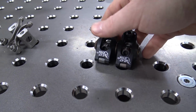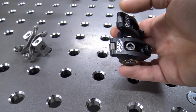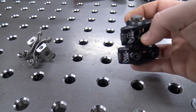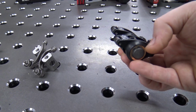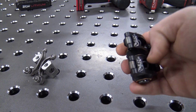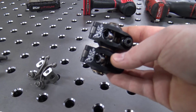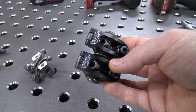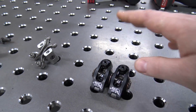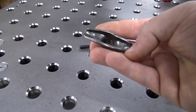Now you can get the gauge rockers on Go Power Sports as well. This is the best rockers that money can buy for these small engines, in my opinion. They have a bearing right there that will set on top of the lash cap, so there's no friction whatsoever. They pivot on this bolt, basically this shaft, and then where it meets the valve, the lash cap, that bearing right there will spin. So there's no friction, and these are 1.2 ratio rockers. You can get these in just standard 1-to-1, 1.2s, and 1.3s on Go Power Sports. Now in the Shredder engine, we're going to be using the blue set of these, which are the Ultralight. They weigh a little less than these, and should be a really good upgrade over the 1.2 stock style ratio rockers this engine had in it.